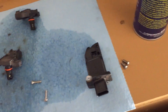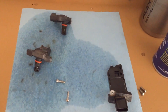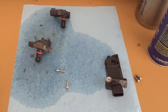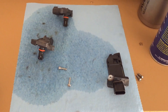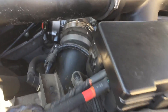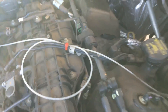Now I'm going to plug them all back in, then reconnect the battery and have it relearn the idle process. As long as the battery maintains connection to the computer, it's going to be constantly adapting and relearning. Disconnecting the battery will cause the computer to relearn the idle speed again, and this should take away most of the hesitation. Here are all the sensors plugged back in and reinstalled — one, two, and three — making sure to keep track of which one's which.